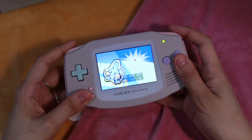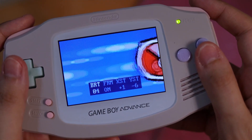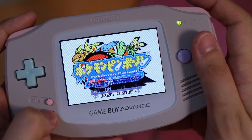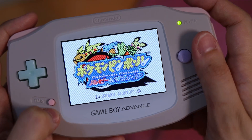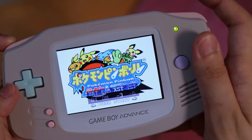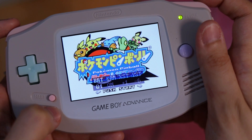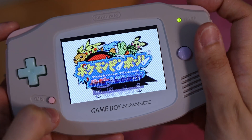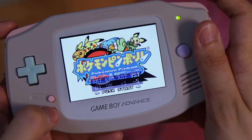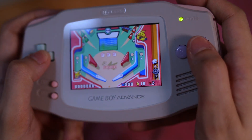Now let's take a look at the features. You have 10 levels of brightness, which you can adjust using the on-screen display — brought up by pressing and holding select, L, and R, then navigating brightness with L and R. You get rid of the OSD by pressing and holding the select button, and navigate options by pressing select. You have FRM, and the X and Y axis that you can adjust. You'd probably do this first thing when you install it and never again. You can also adjust brightness by tapping the top of the console where the touch module is.